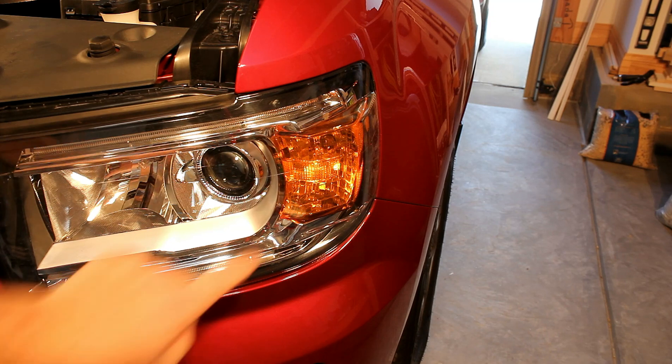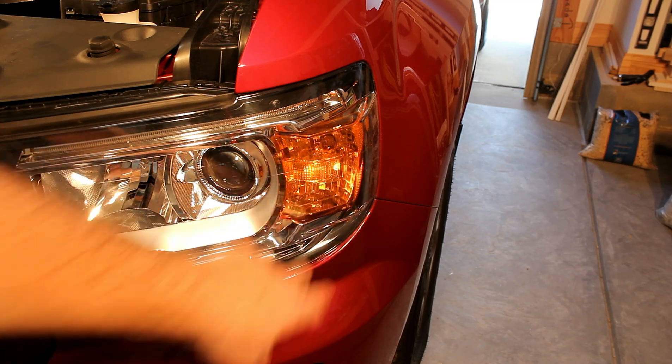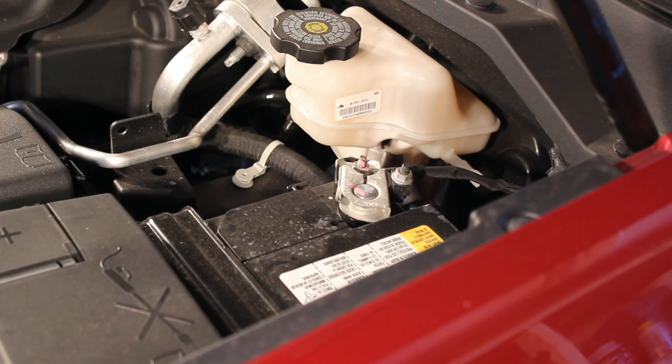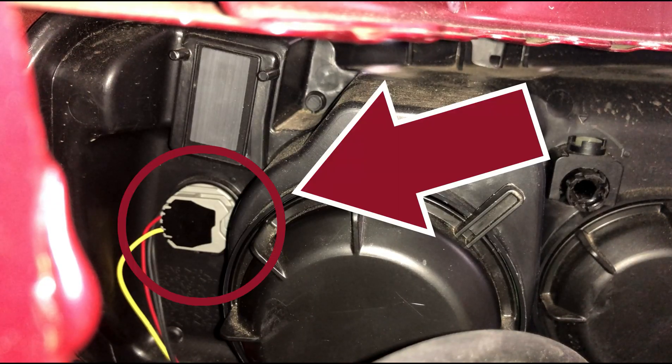The first thing I'm going to do before any wiring with the harness is replace the bulb in here with the LEDs. On the Colorados, that bulb would be down on the left, which is where the running parking light and turn signal are. On the Canyons it's over here, so it's a little more difficult to get to behind the fender. First thing you want to do is disconnect your negative power cable from your battery and set it aside. The parking lamp/turn signal connector is on the left side of the headlight housing on the back side — that connector right in front with the red and yellow wire. Simply turn the connector and it reveals the bulb, then you can pull the bulb out and reinstall your new bulb.